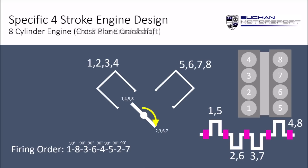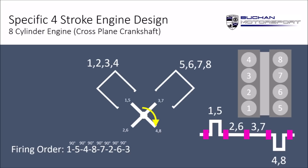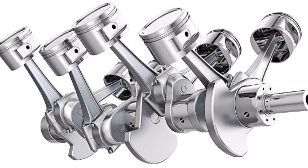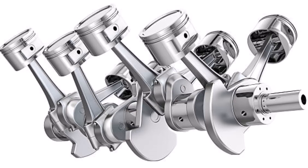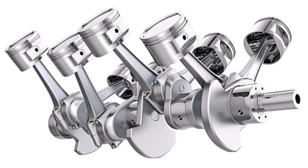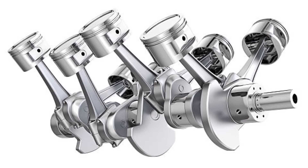But I could also design a crankshaft which has a crank pin every 90 degrees, because that's the firing gap I want. If I do that, I have more possibilities to spread the ignitions across the engine. Hence the engine is smoother, the sound rumbles a bit more because I don't have the same firing gaps on each bank of the engine, and the crankshaft is a bit heavier because I need counterweights. That is the crossplane crankshaft. So a crossplane V8 is a bit heavier, has more inertia, revs up more slowly, sounds different, but is smoother.